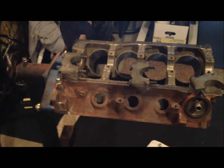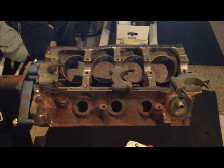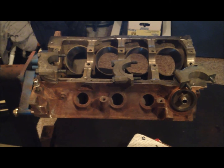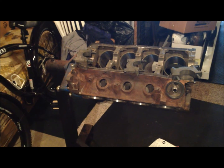You really want to make sure you have proper quench because when you use aftermarket pistons, they're often a little bit shorter, so they'll sit in the hole a lot farther than stock pistons. This is because a lot of engines are rebuilt by warehouses that automatically deck the block down a certain distance, so aftermarket pistons are made shorter for that reason. When rebuilding at home, check this distance and deck your block accordingly for your specific pistons.